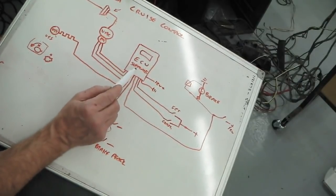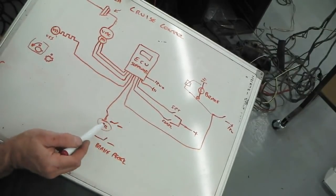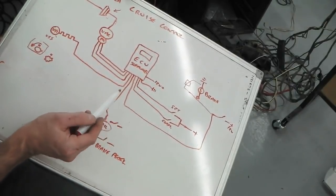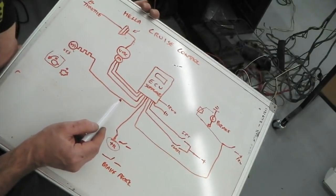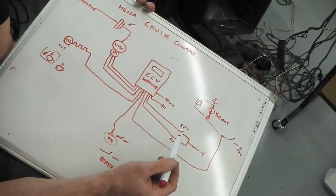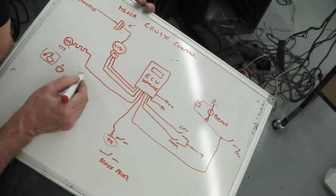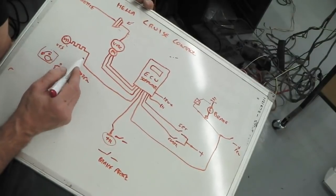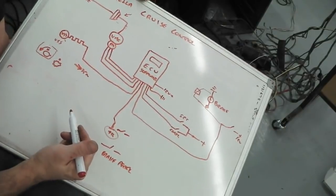So we'll connect 12 volts to the ECU, we'll connect the switches here to it, we'll connect the safety override on and put it onto 12 volts, we'll just loop that across to the 12. We'll connect a speed input, which I've got a simulator on the bench, I'll show you that in a sec. We'll connect the motor up, and then by pressing one of the switches, as long as my speed is at the correct speed, that is over 35 miles an hour, which we just have to guess what that ends up being. You just trial and error it on the speed simulator on the bench,